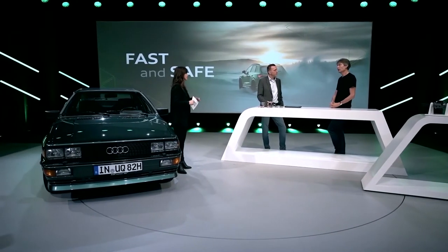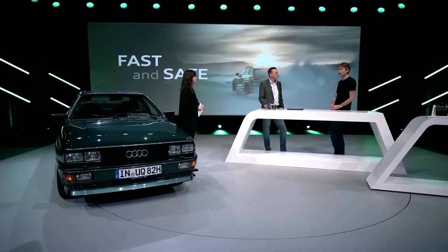And when you have a torque split that's quite clear, a little less at the front, a little more at the back, then the consequence is that the car always has a very neutral or slightly oversteering reaction, which on snow and ice is simply the much better drive behavior. And for the customer then, predictable? Indeed, very predictable and easy to drive for the driver or the customer.